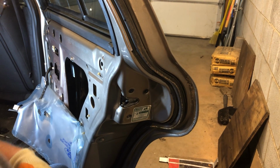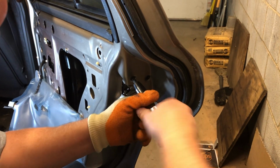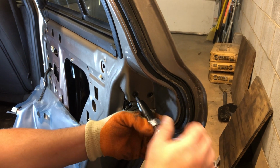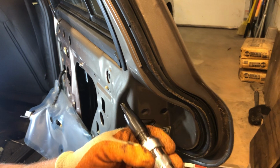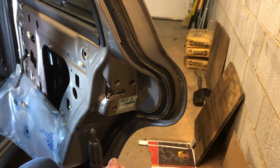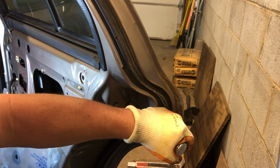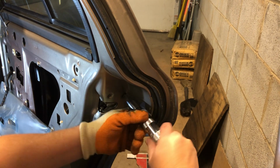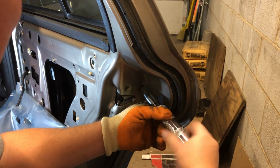For sake of time, I'm gonna go ahead and tell on myself. I went ahead and hit all these with it. It's a pretty hard hit. I used to do this on a lot of Volkswagens, and that's why, if you look at that thing, it's mushroomed all around the end where I have hit it so hard to try to get a Phillips screw out. I did a door hinge on a Volkswagen Karmann Ghia one time and other times. But like I said, you want to wear a glove, because it's going to bounce some, and you're going to hit that thing as hard as you can while you're turning. But like I said, I've already broke these loose. This is the last of the 3. You can just take it right on out.